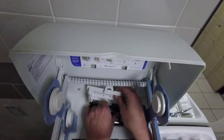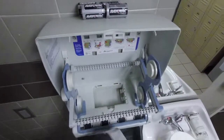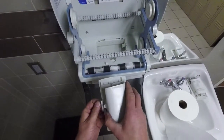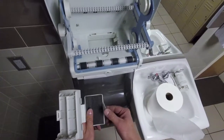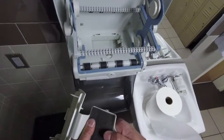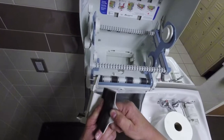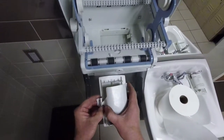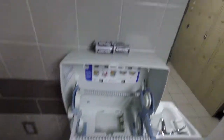So one way to fix this, and it's really easy, is take your batteries out, take your carrier out, and open it up. What happens is it does not clip right here. An easy way to fix that is to take it like this, open it up, and take the offending part, which is this right here, and bend it as if you want to break it. But the ironic thing is it's not going to break — it will bend out far enough that once you put it in its little housing, its little clip, it will hold the batteries.